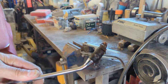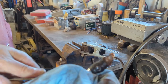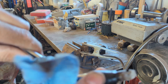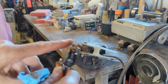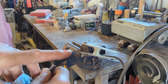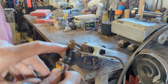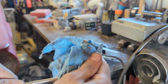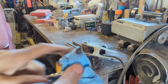We've got the lever off the car. Clean it up and I'll show you what needs to be done. You can start to see — it's got a good amount of grease on this one. This groove that's cut in here shouldn't be like that — it needs to come out. We need to weld it until it's square and flush all the way around. That groove shouldn't be there at all; this side should look like the other. I'll get it in the vise. I'm a little tight on quarters right now — I was doing some brake disc work, had the brake lathe out cleaning up brake discs on the Sprinter van.